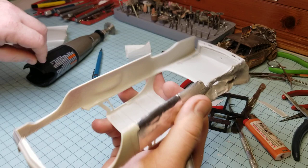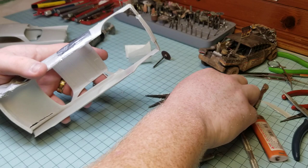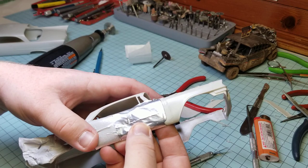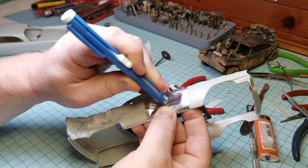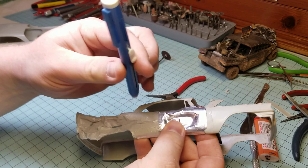So there's your basic outline of the door. I'm not going to do the back seam just because I didn't trim the back seam on the quarter panel piece either. So you can take your cage, if I did this correctly, which I don't quite know if I shaved it down flat enough behind the door or not, but okay. Hold that in place. It's a lot easier when it's attached to the floor and it's in there the way it's supposed to be. Okay, and you press your outer door skin in here. It helps to hold the cage in the right spot too. Okay.